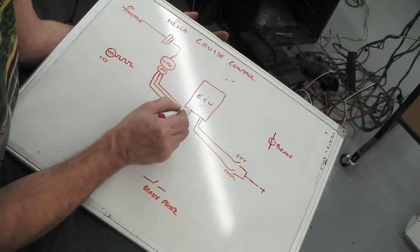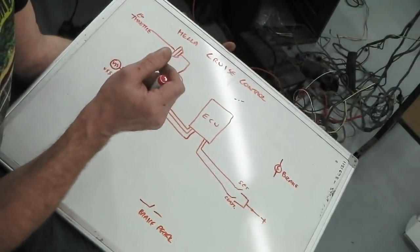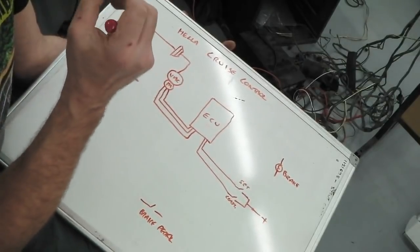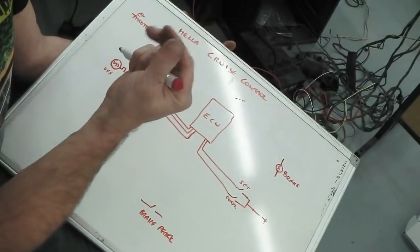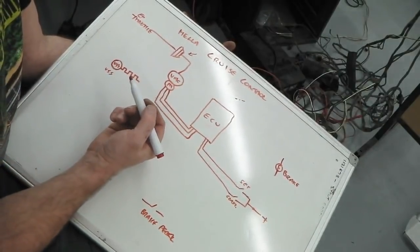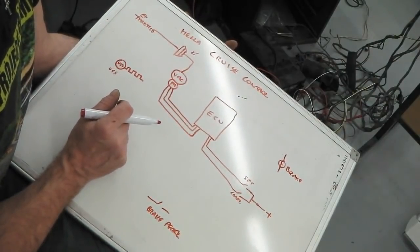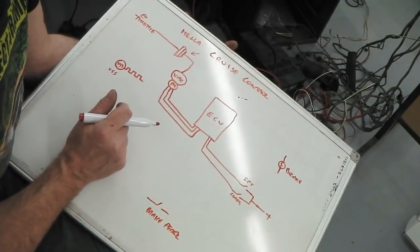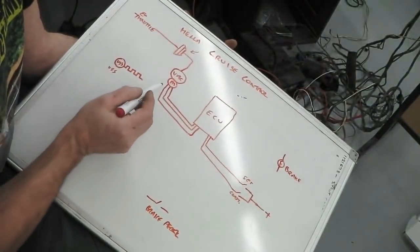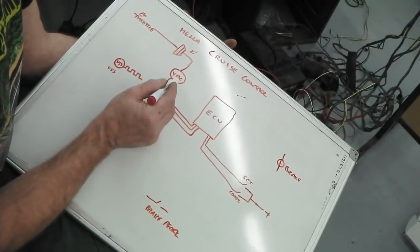What the motor is able to do is create the vacuum in the bellows, and atmospheric pressure then pushes on it. If you suck on a straw in a bottle, the bottle starts to collapse because of the atmospheric pressure. Anything where you create a vacuum, atmospheric pressure pushes on it. Or if you blow up a balloon and then suck out, the balloon shrivels up like that. Negative pressure. The vacuum pump, motor and a little dump solenoid make three items.